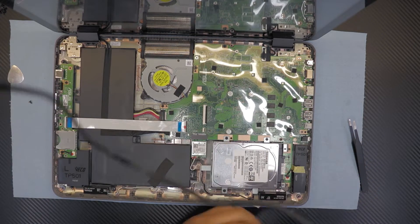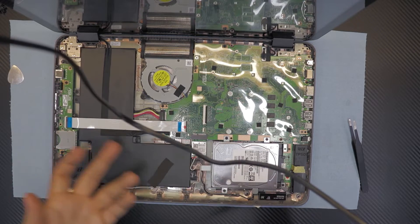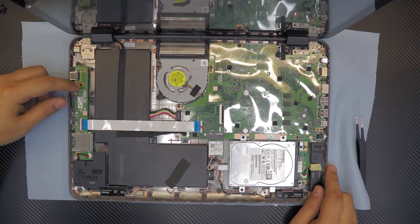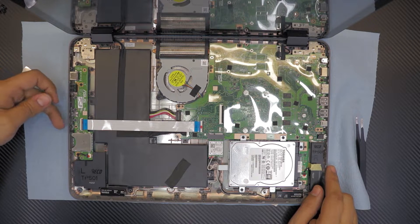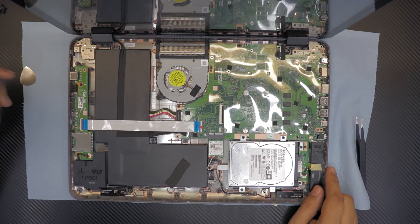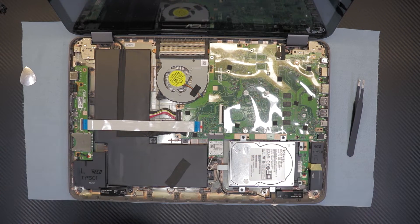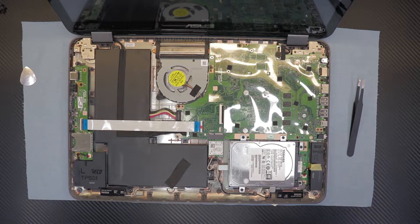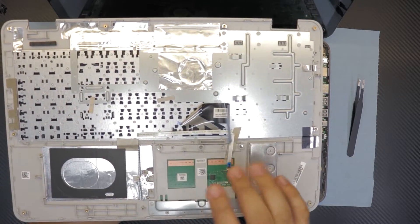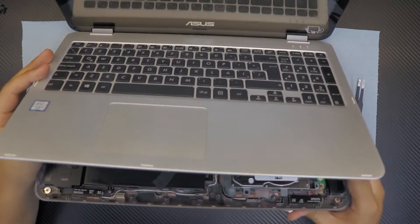If you guys have any questions or doubts and want me to reopen it to show you more about the parts, let me know in the comments. On this side there's only one or two screws that hold in this port - one USB, volume rocker, power-on switch, and a memory card reader attached to the left speaker. Now we're gonna put the top cover back on. If you want to change your mousepad, there are three screws that hold it in - unscrew those and it falls down the other side. At a 45-degree angle slowly slide it in, then slide in the keyboard and close it up.